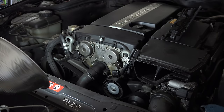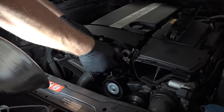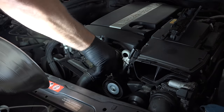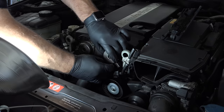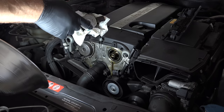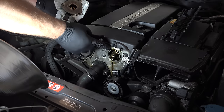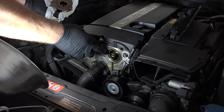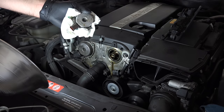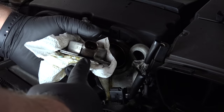Here's the part and you can see it's kind of oily. The back just sits flush against this gasket or o-ring here. This o-ring is about seven dollars — I got it from Mercedes-Benz — and then there's a little rubber grommet that's about two dollars inside there. We'll put a new one in rather than transferring the old one, just to be safe.